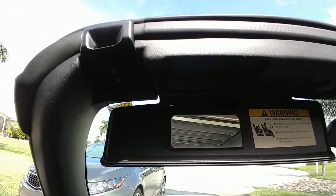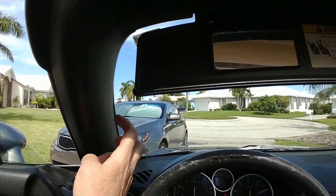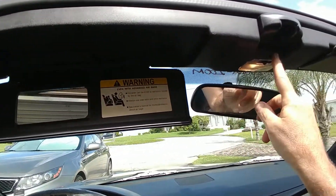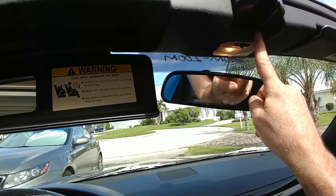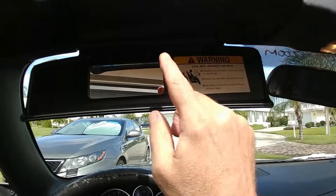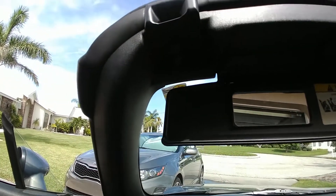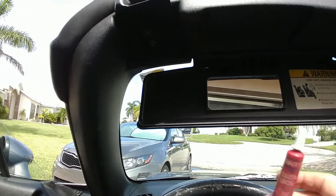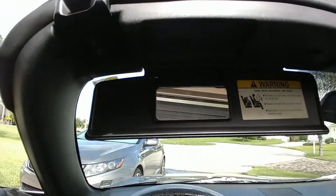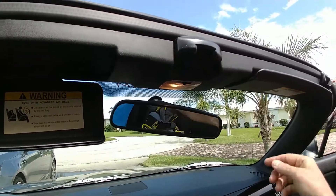Word of wisdom: when you put this back in, it's pretty easy. You've got your A-pillar cover — just two locations that need to snap in. Same thing here, one snap in right above the headlamp or the courtesy light. Then there are six Torx bolts to go in. I've had these Torx bolts loosen out, so what I do when I install them is use a little bit of blue Loctite on all six — that way you know they're not coming back out or falling on you. Questions or comments, leave them below. Thanks.